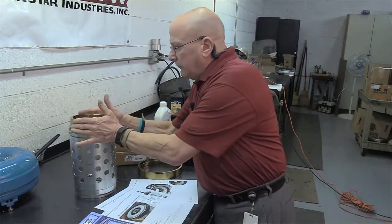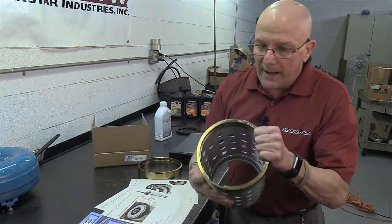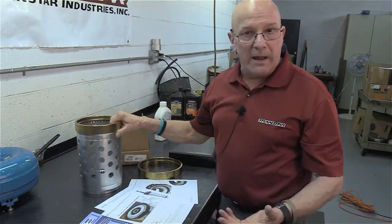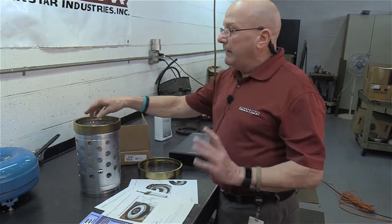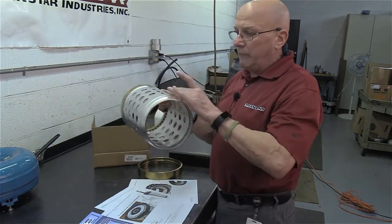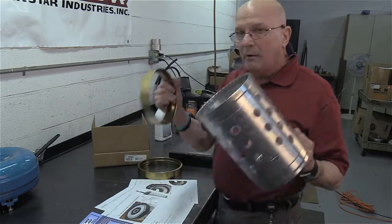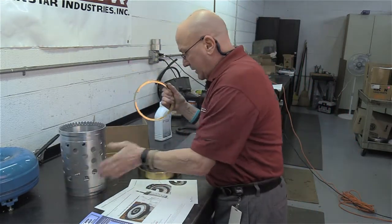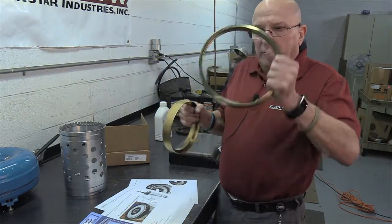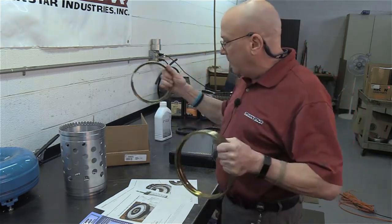What you do is, before you take it apart, slide it on the drum. It has an indent. Now you pry your snap ring out and save the drum. It is a must to have. If you break the drum, you're going to have to replace it. There are different drums, and some have magnetic stripes on them for speed sensors and such. So again, just protect yourself and get the rings. There are 2 different size rings, because the bigger unit takes different ones. Plus, you can flip these over, so there are a couple of different sizes. It covers all 4 rings with 2 pieces.